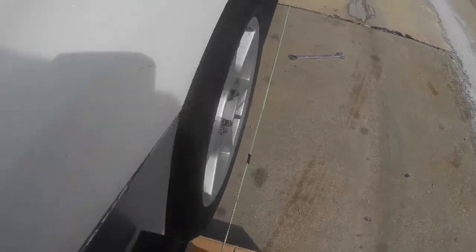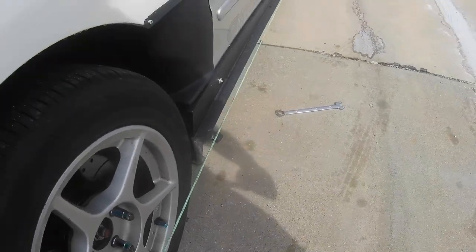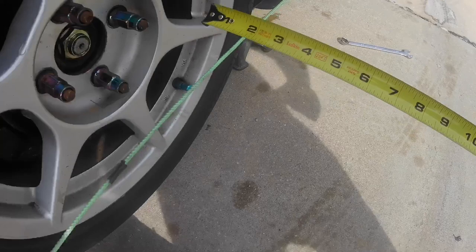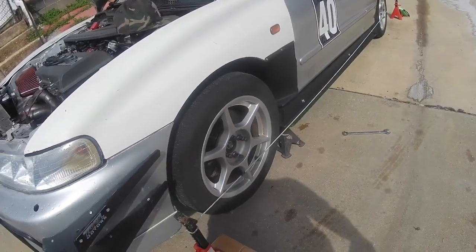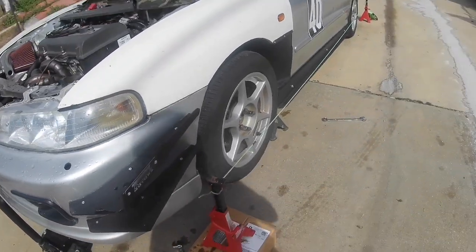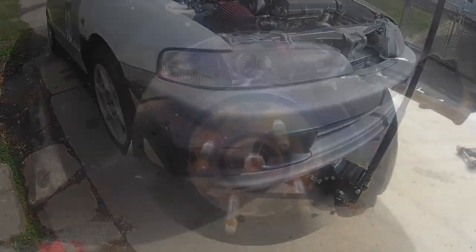It's definitely much better than it was — the wheel's pretty much straight now. Taking my measurements: it's about one-eighth of a tilt facing outward. Right back here I have one and seven-eighths, and up here I have two — so that's good enough for now. I just need to drive to the alignment shop, which is about five miles from my house. I'm going to go back underneath, tighten up the jam nut, jack the car up the proper way, and start working on the other side.